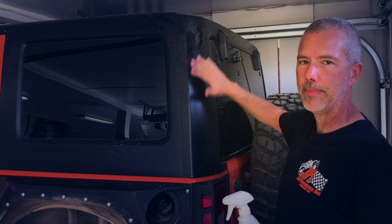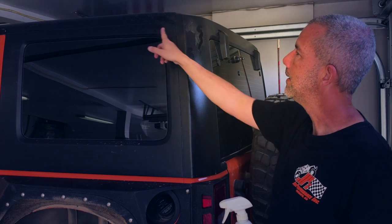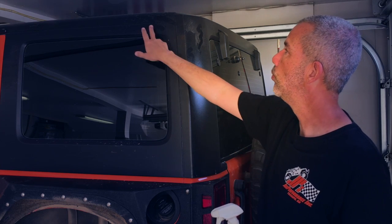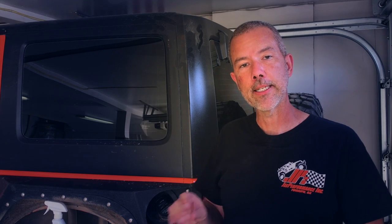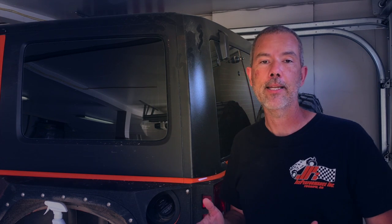What we've learned here is that the difference is minimal. I'd say it's probably still worth using Aerospace 303 because where I applied it before going in the dust, it did look really good. But where I didn't buff it out the way you're supposed to — if you don't follow those directions closely and really buff it out and make sure it's dry — it's really going to attract the dust, and that's what happened the first time. So does it repel dust? No, not in my test. Should you avoid it? I'm still going to use it — it's too expensive to throw away. If you use it right, buff it out, rub it down really well, make sure it's completely dry, it does look good. It makes your blacks look rich and deep, until you get near dust and then all bets are off. Not a bad product — it doesn't do one of the things it claims, but it does do everything else. Apply it the right way and be aware it won't repel dust; it will in fact attract it just a little bit more.